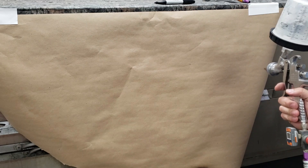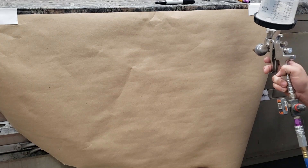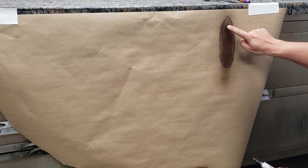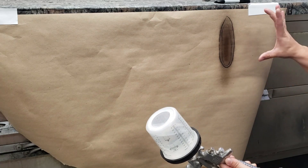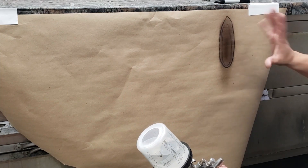What I've got set up is just a piece of craft paper — any kind of paper or a cardboard box will work. We're going to test our spray pattern and see if we need to make any adjustments. Hold your activator gun about 12 to 16 inches back from the paper — that's about how far you'll be spraying activator — and give it a good squeeze to see what the pattern looks like. So here's what we've got: a really heavy spot right in the middle, and then a lighter area to the outside. It's about six to eight inches wide, which is pretty normal for budget-style spray guns. We're going to make an adjustment on the fan to tighten it up a little bit and get a thicker spray pattern.